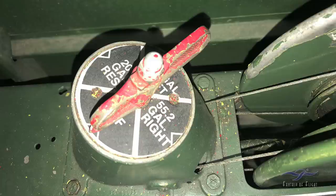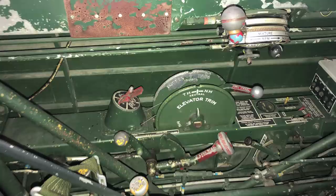Here we have the fuel selector. It's in the off position currently. There are basically two fuel tanks in the center section — one on the right side, one on the left side — basically 55 gallons. There's a selection for a reserve that's actually in the left tank, which allows you to get absolutely the most fuel out of that left tank. Generally we take off and land on the reserve.